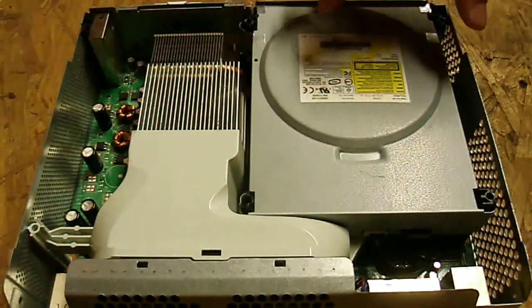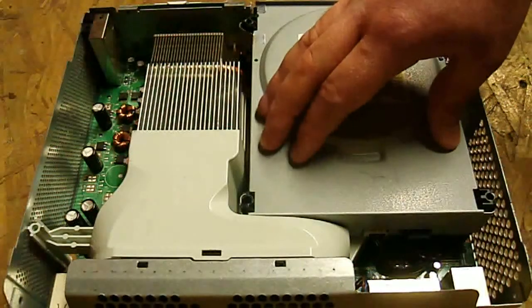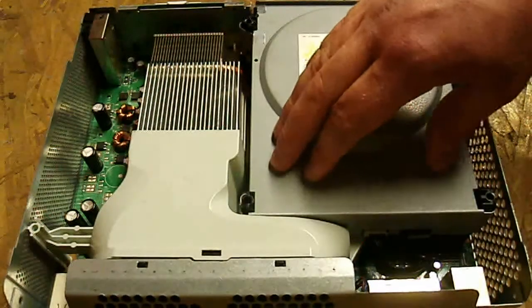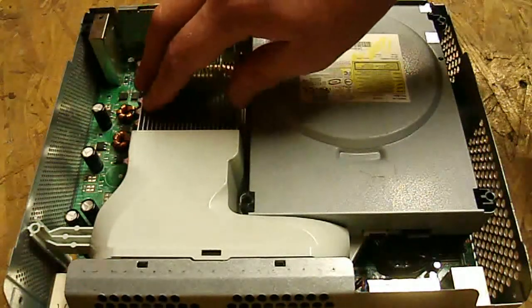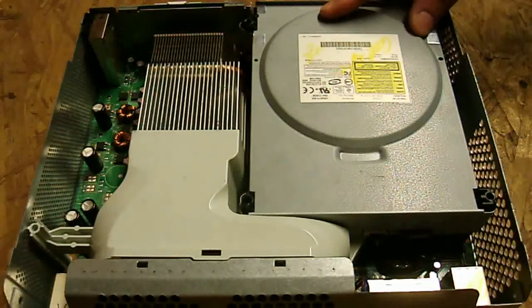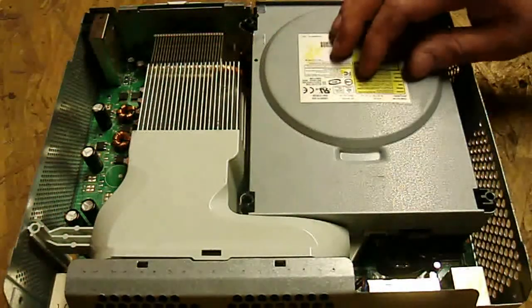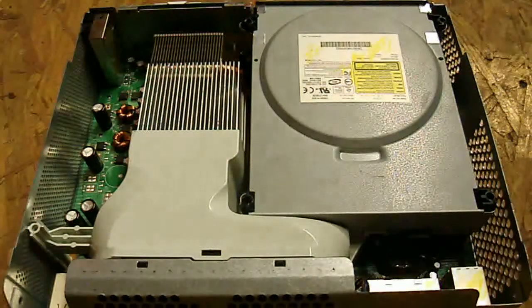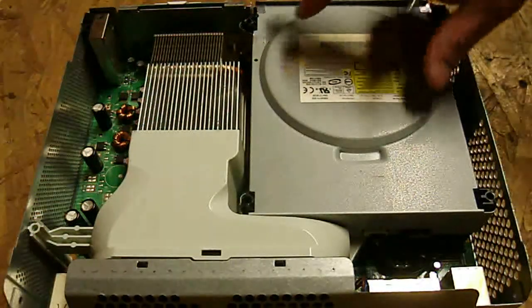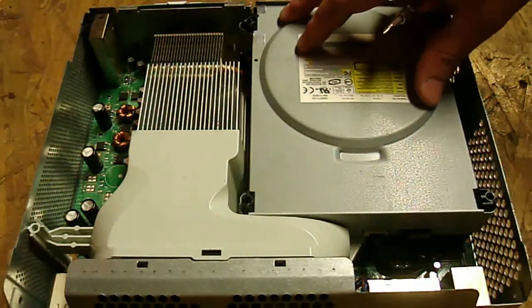The reason is that the trick you have to know when you switch these out is that you have to take the PCB — which is short for printed circuit board — out of your old drive and install it into the new drive. There's a unique key in each one of those that matches the motherboard, so you have to have that match in order for it to play games. With the BenQ you do have to do some soldering because the motors are attached not just with ribbons but with wires directly soldered to the disk drive. You'll need a Phillips head screwdriver, mainly just to take off the outer case. If you're not sure how to get to this point where it's already opened, I'll put a link in the description to another tutorial showing you how to open it.